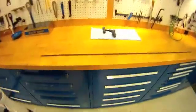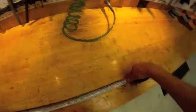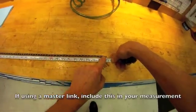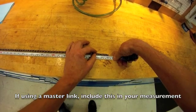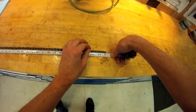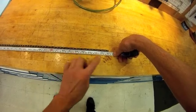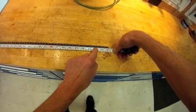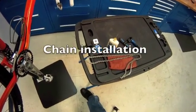If we go over and measure our chain, starting at one end with the tape measure even — 55 inches would be right here: one, two, three, four. That fourth rivet once again. So it comes out the same. Just two different methods, but the practical method — when in doubt — is always a good one to use. Simply wrap it large to large. So I'm going to cut that fourth rivet. The chain is now shortened to our correct length.